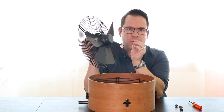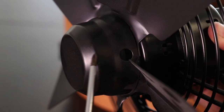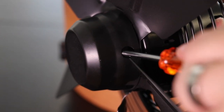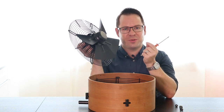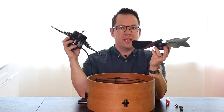Now if you want to fix the fan blades on the axis, you will need to look for an opening — a hole. In there you will find a screw. What you want to do is loosen this screw. Please make sure not to loosen it too much; if it falls out it's really difficult to get it back into position. Once it's loose enough, you can then remove the fan blades.